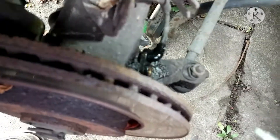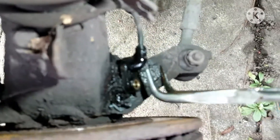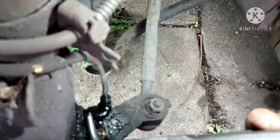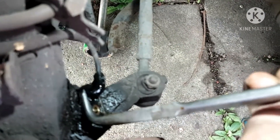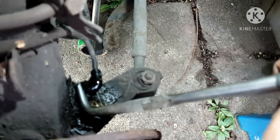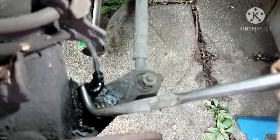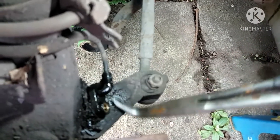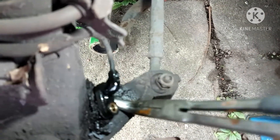I'll probably have to get something on there — usually just a pair of pliers. Just very gently, back and forth, give it a little wiggle and they normally come out. Usually something like these here, going back and forth. Now these do break, so take it easy. They are plastic and they do get seized into the hub. I just want to give it a little wiggle here to break off that corrosion. Ever so gently, ever so nicely — just want to pop it out.